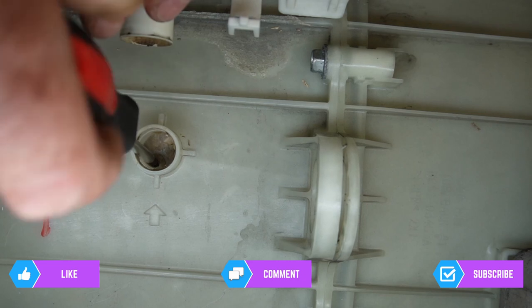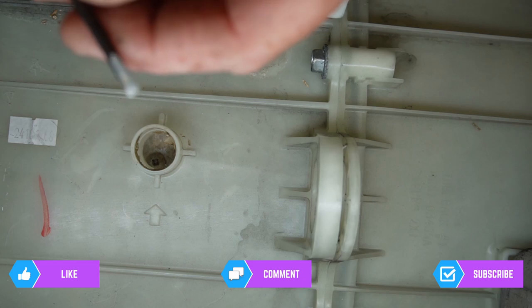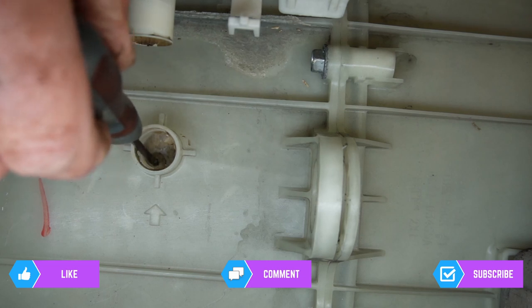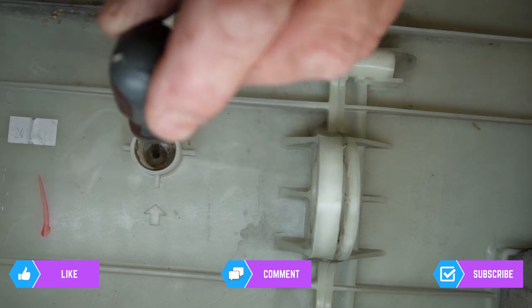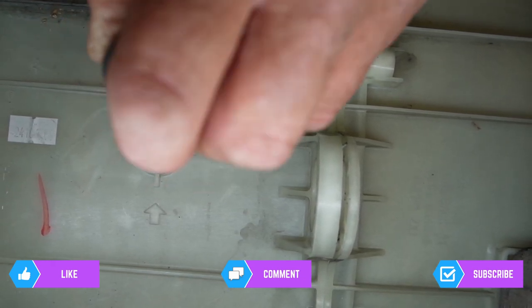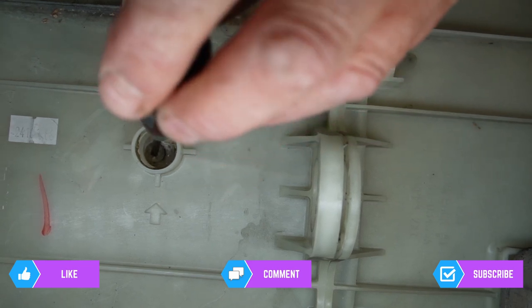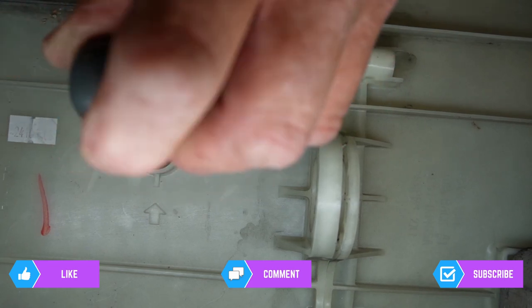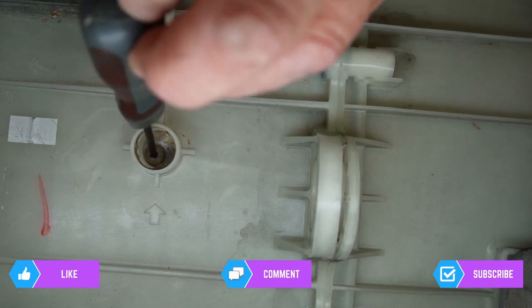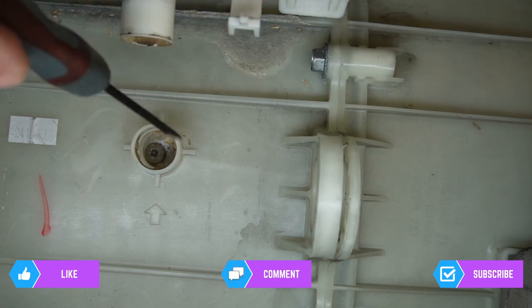It's very important that you clean this out before you even try to undo it, as you may round the head of the screw. But if we go around to the bad paddle, you can see the screw is slightly loose, but there is very poor head left. Now this should be a Phillips, but turning the Phillips I can't actually undo it. So if you use a flat blade screwdriver — make sure it's got a head that fits in perfectly — and I'll try and get my hand out of the way while I turn this. I've got to put some force — there we go. You can see the screw is turning, and that's because I'm using a flat blade screwdriver with a sharpened edge to actually get in there.